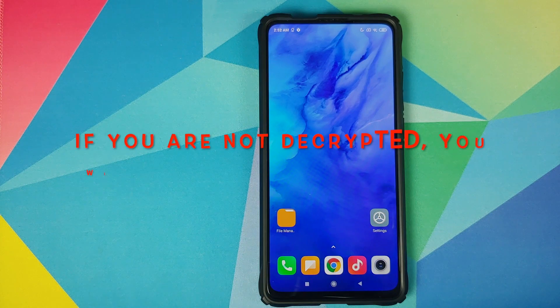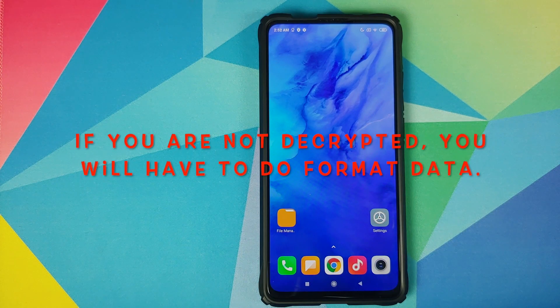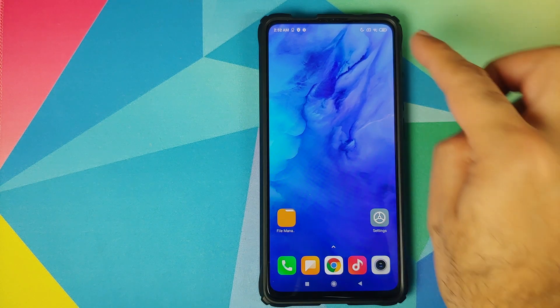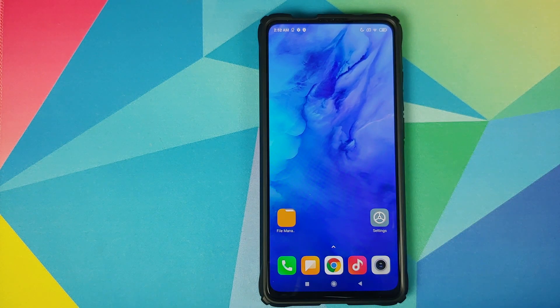How do you decrypt your device? I have a separate video for that as well, which can again be found in the description of this video. Next, make sure your battery is charged at least 50 to 60 percent — do not do this process if your battery is at 20 or 30 percent. Also make sure you have a backup of all your pictures, videos, and anything important, because if we run into any boot loops we will have to do a format data from TWRP recovery, in which case you are going to lose all your data.